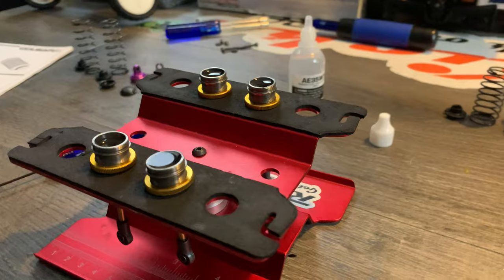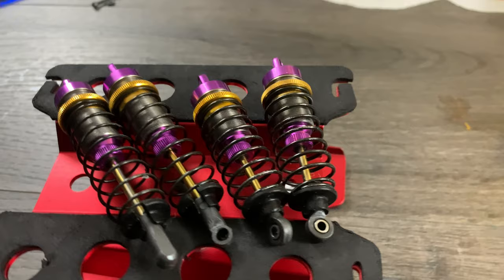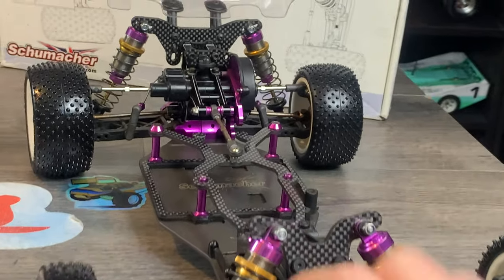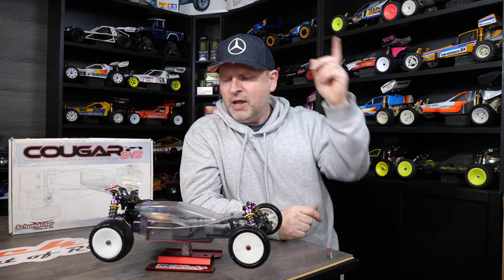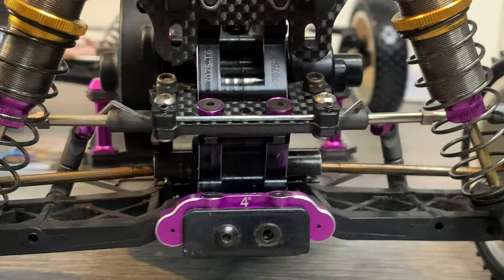The shocks came with no oil in them at all — I think it had just been parked up to go on the shelf — so I refilled the oil. I did have two issues with the shocks: one was missing an O-ring, so it leaked straight away as soon as I rebuilt it. One seemed to be fine. And one of the top caps had a bend in it, so it must have taken an impact at some point, but I managed to bend it back without removing too much of the anodizing, so you wouldn't really know. The optional anti-roll bar kit was in the box, so I put all those little pieces back together again and reinstalled it.